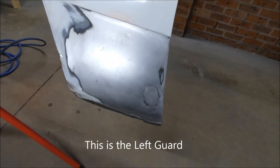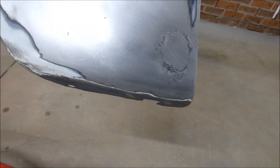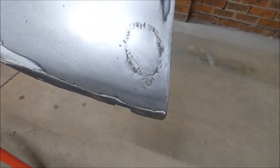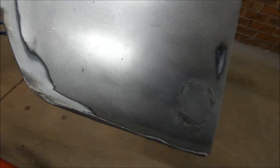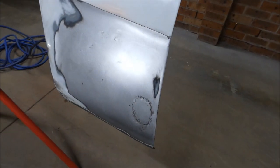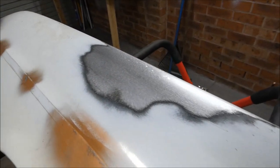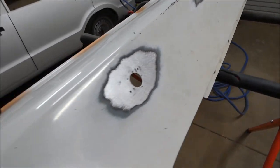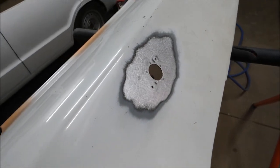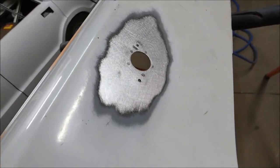I've been hard at it. That's the rust patch I've put in there. It's still a little bit pitted on the back in a couple of areas, so you've got to be really careful when you weld because in some spots it tends to try and blow through. The bottom area there took a little bit of extra finessing and ended up welding over the badge holes — they're all done. That bottom area is straight enough now for a skim. Got the dent out of the top here — all been body filed and sanded. Same with the aerial mount hole — it was a little bit buckled from people over-tightening the aerial, which tends to pull and buckle. That's all good now, nice and strong as well because it was a little bit flimsy.